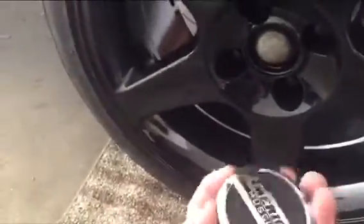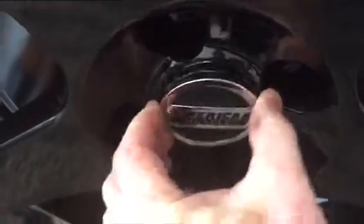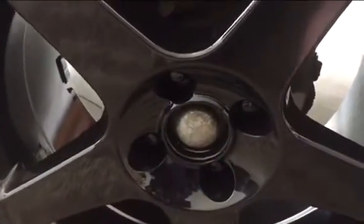I did run into some issues in the front. The first thing I noticed is that the center cap for the rim will not go on — there's a very slight difference where the cap is in the way. If you want that cap on, a spacer would work, but you're probably better off just blacking it out. The bigger problem is that near the shock tower, the shock is only about a sixteenth of an inch away from the rim.